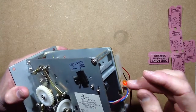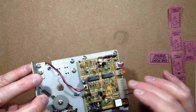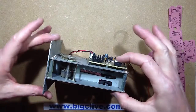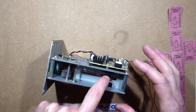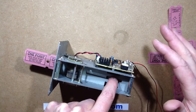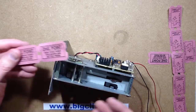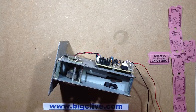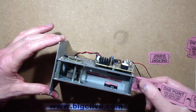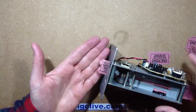This little orange LED is the signal to the machine that tells it it's out of tickets. This terminal deals with the actual vending, when tickets have been vended, and the number that they've been counted out. When it's run out of tickets, it doesn't matter if you press the test button — it won't vend a ticket at all because that switch needs to be pressed. If I press that switch now to show it's got tickets in, it'll wind them, but it'll actually wind two out in this instance, because it didn't detect the gap. It also stopped after a while because it's got a timer that says it's taking too long for that ticket to be vended, so there's something wrong and it'll stop vending. So to reload it, you simply get the tickets, shove the new ones down until you get down to the wheels and it can't go any further, then push the button while putting a bit of pressure against it, and it winds the ticket in and it's ready to vend.